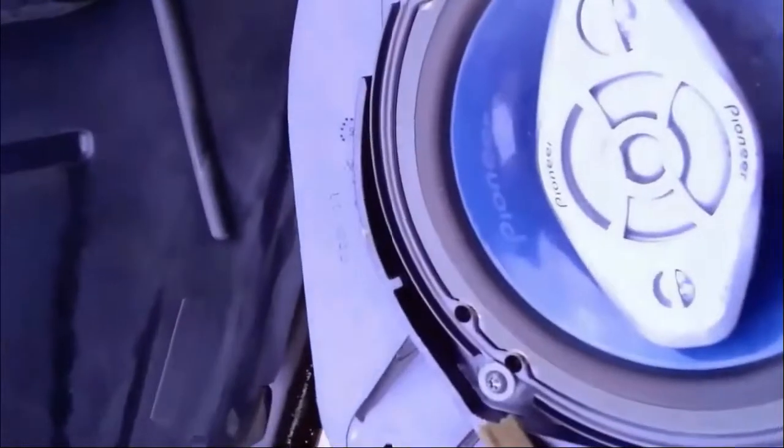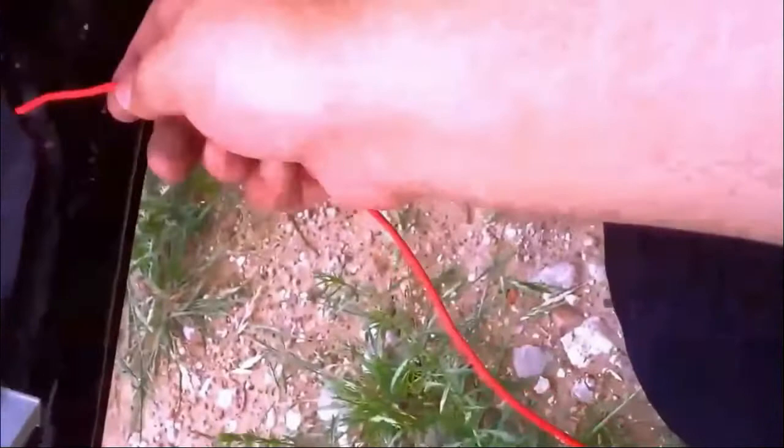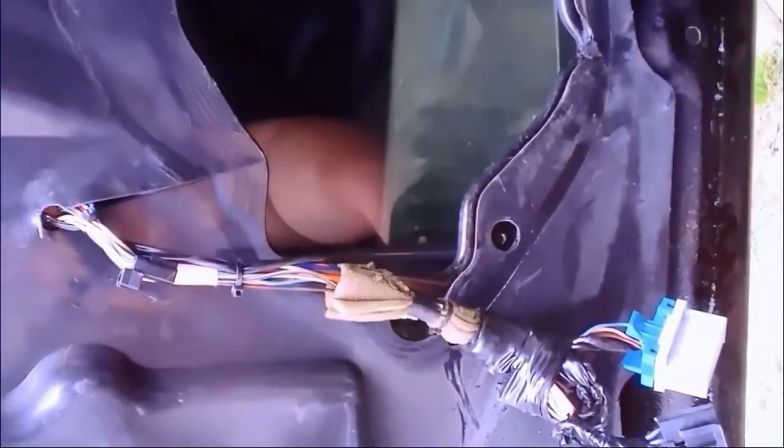This is like a little plastic holder thing. I think the speaker is a five-and-a-quarter inch. I cut up about a foot of extra wire to test the old tweeter and to install the new tweeter up toward the top of the door for better sound. I have a lot of bass but not enough treble. My stereo is really good at treble through the component speakers, but bass uses more power so I'm not getting enough — that's fine because I want treble here and bass from my sub.